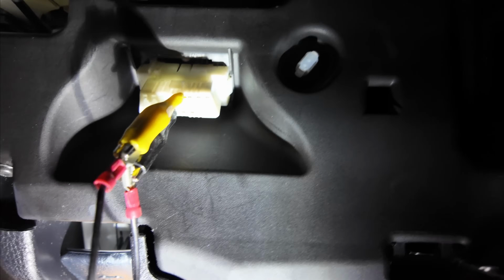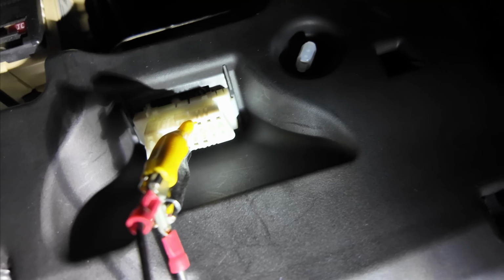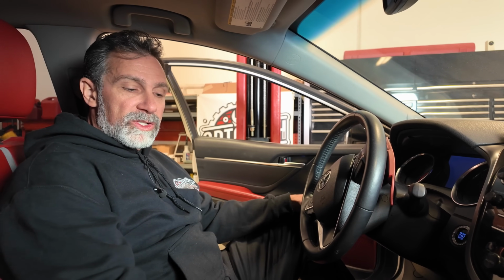And we're going to follow this procedure exactly. Once we start the vehicle up, we're going to move this shifter from park down into drive, slowly back to park, leaving a few seconds in each gear selection. Okay, once we've done that, then we're going to take this shifter, we're going to put it all the way down to drive, and we're going to go back and forth between neutral and drive. We're going to do this about a second in each. You need to be less than 1.5 seconds in each position. So down to drive, less than 1.5 seconds, back to neutral, back to drive, back to neutral, back to drive. We're going to repeat that process for at least 6 seconds.